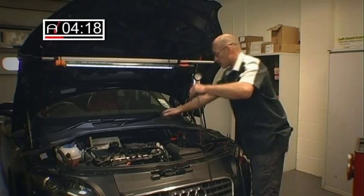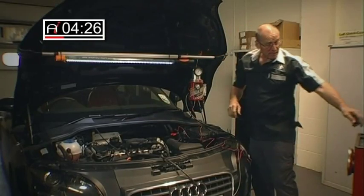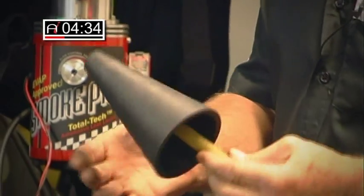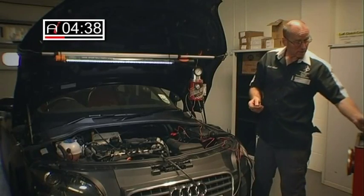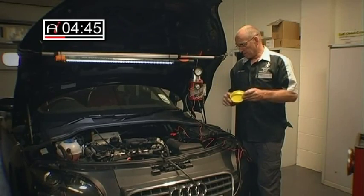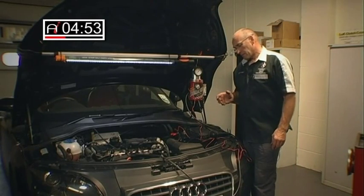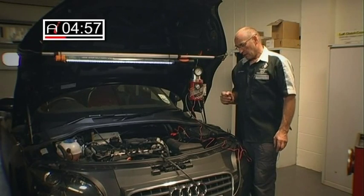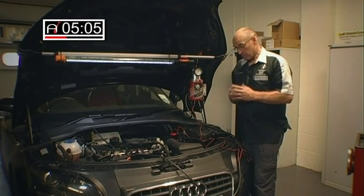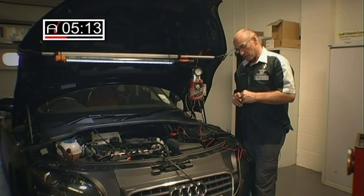So all things are possible. That nozzle fits, in our case, into a conical adapter. I have a similar adapter here — that's one of the basic tools. If you've got a suitable round inlet orifice, that works quite nicely. There are a number of devices of different shapes and sizes that can be used to seal or blank off a hose or a fitting. What we're actually attempting to do is to provide an inlet into the induction system at a point that would reach everywhere. The inlet manifold is an obvious one; in our case we've got to the main air intake.